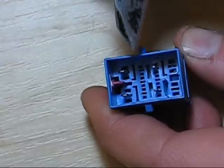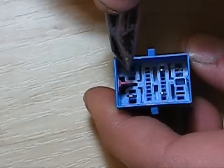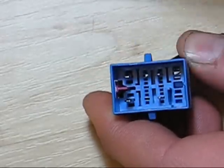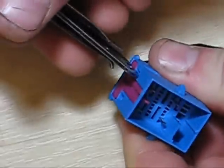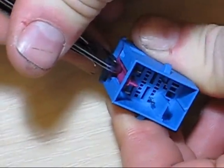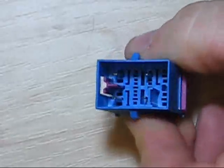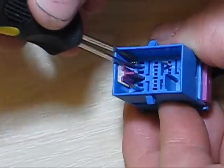To get the terminals out of here, I need to slide the secondary barrier over - there's a little space for it to slide into. Oftentimes, secondary barriers, if you look closely, you'll see which way they're able to move, and sometimes they have arrows. Click - there it goes. Different types of barriers will have arrows on them pointing you to which direction they're moving.